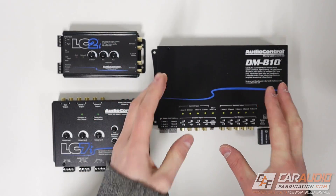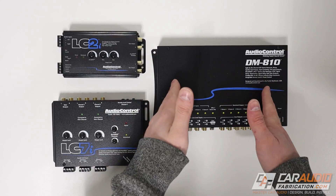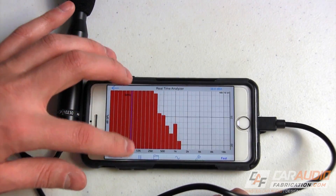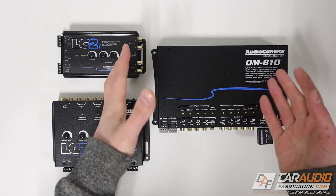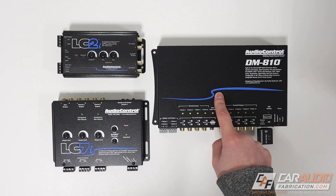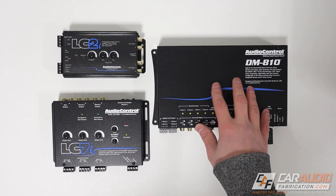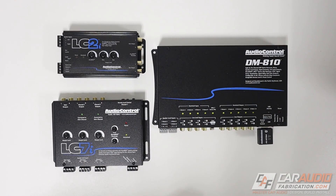If you want to truly have full control over your sound and be able to tune your audio system, you're going to want to choose the DSP. But there is something important to understand — when you go to tune a DSP, you're likely going to need other tools like an RTA, which is a real-time analyzer, to fully set up the DSP to its full potential. I've actually seen a lot of cases where people install a DSP and then basically use it as a line output converter — they don't control the EQ or set any time alignment. Make sure you do your research on how to tune.